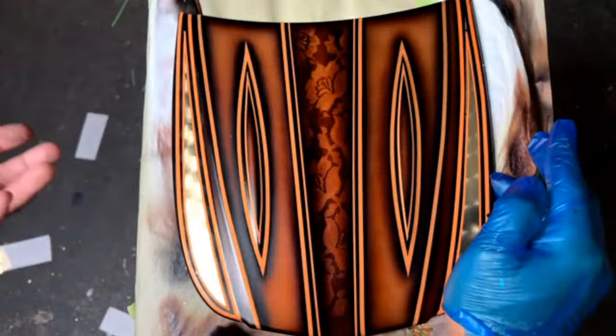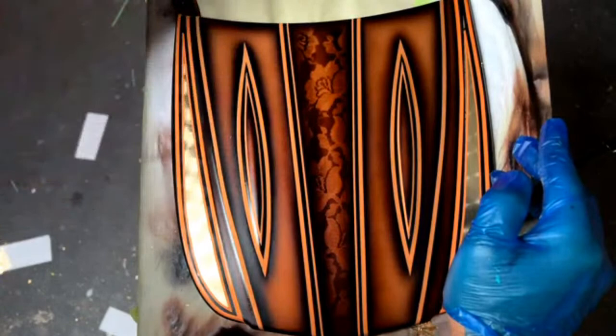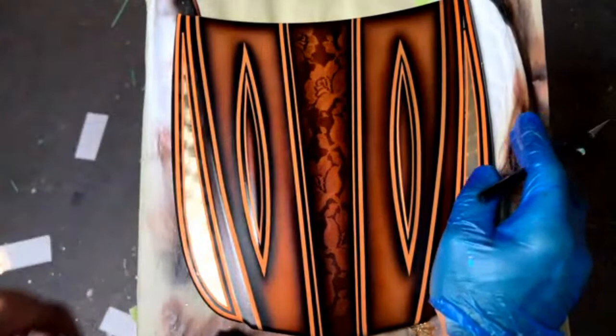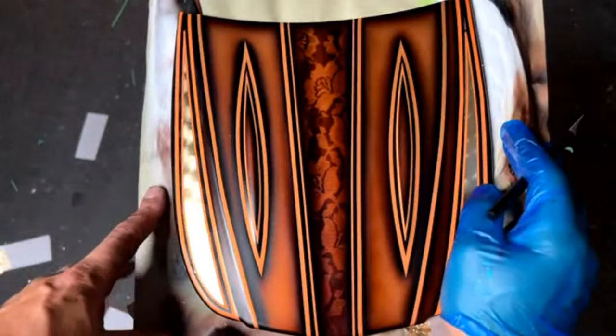It's not easy to do taping on top of your existing base coat. If you clear it and you sand it, you basically protected everything from that point down, and if you have to do any kind of erasing or anything like that, it's much easier to do. And as far as taping out, fixing little errors, much easier to do on sanded clear coat.